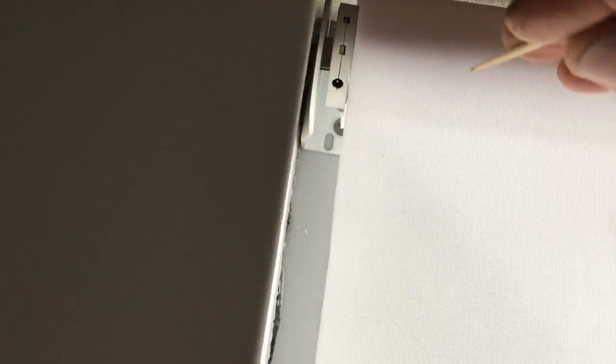The first part of the pairing process is to press and hold down the middle button on the blind for about four seconds. The red light flashes once and then stays on solid. While it's solid, go to the back of the remote — with channel 2 already selected — and press the button in the middle at the back. That locks it into the channel link. When you press it, the light flashes, and then you press it again to activate and acknowledge. The light goes off. Now if I press the down button — in this instance you may need to reverse the direction, which is all part of the setup — it confirms the remote on channel 2 is paired with the blind.